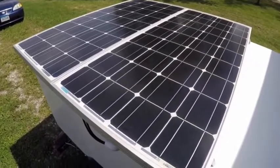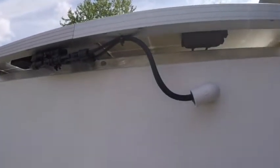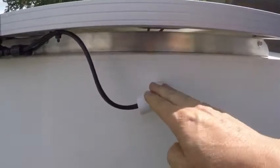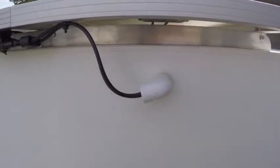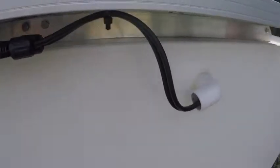I've got 200 watts of solar — two Renogy 100-watt panels up top wired in parallel, so it's 12 volts. The wiring comes into this side hole through a 3/4 inch PVC 90-degree corner fitting. I poked the wires into it and stuffed it full of foam so I can easily pull the wires out. I also angled it down slightly and it's underneath the solar panel, so direct rain shouldn't hit it — and if we're driving in rain, water should just wick off the bottom.